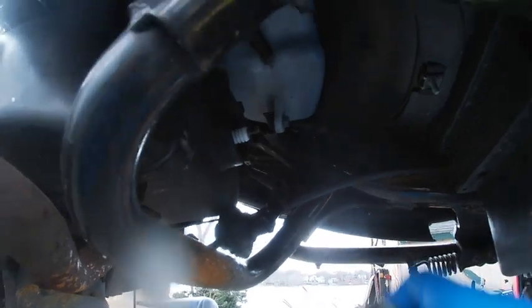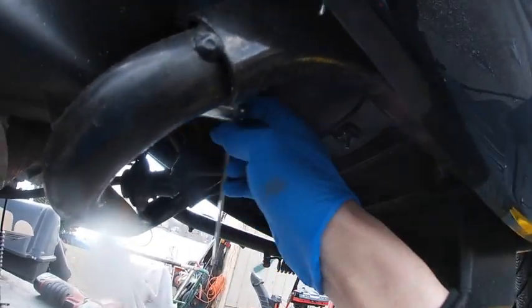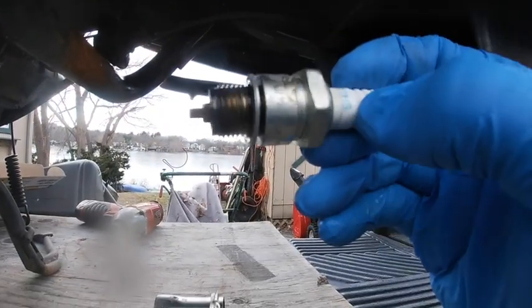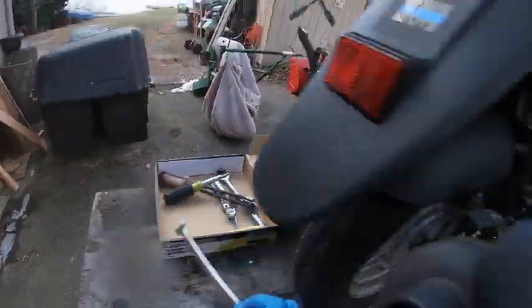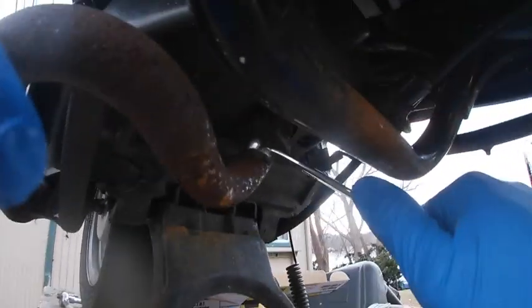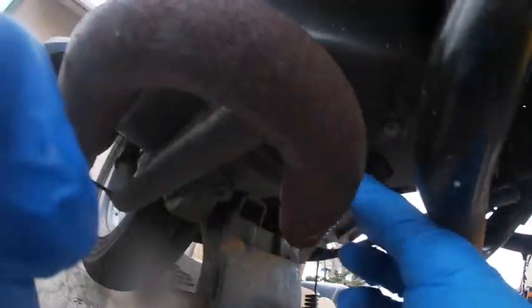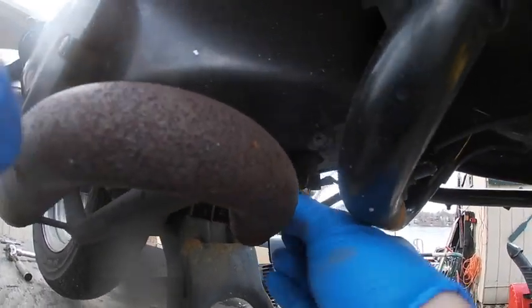On this side we're going to remove those two screws and pop the carb off — we're replacing that one. A couple of screws on this side as well and boom, we're in. We're going to start by taking off the spark plug. Pull the boot off — the spark plug wrench is actually underneath the seat in that purple bag. Spin it loose and let's take a look at it. Very very clean, hasn't been in there too long. Next take the two acorn cap nuts off the exhaust manifold.